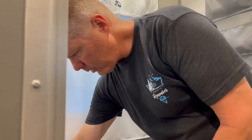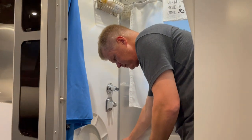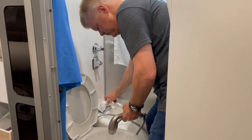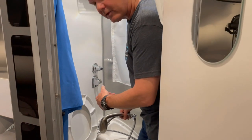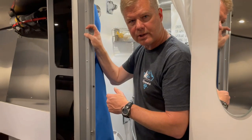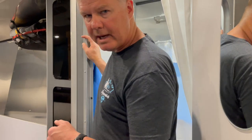I'm going to come and turn on the cold water in the shower as well. That should be enough — we've gotten water into the faucet line and into the shower line. Now we can let both the tank and the water lines sanitize overnight. We'll come back after it's set overnight, flush out the system as the next step, getting everything from antifreeze out to a sanitized tank.